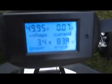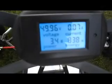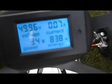And then I checked on our speed controllers here, and the low is 42 volts. So our speed controller should shut down at 42 volts, way before our battery pack is low. So we still got almost 50 volts down to 42 to go. Alrighty, here we go.